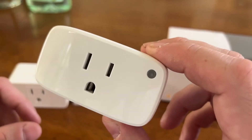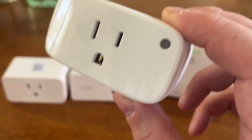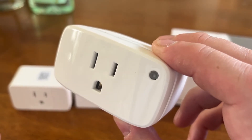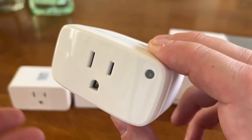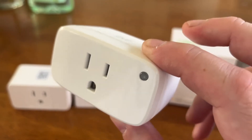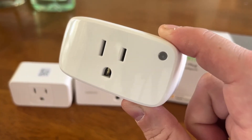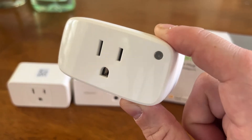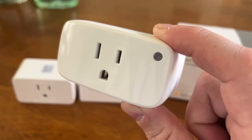The wash notification is particularly tricky because the power draw in your wash cycle is not constant. Like when your TV is on, your TV is drawing power or it isn't. Your washing machine will at times be agitating, at times pumping, at times it will sit and soak. And when it's soaking, it's drawing practically as much power as when it's off. And depending on whether you have three heavy comforters or two t-shirts, you can have significantly different power draws over the same part of the cycle.